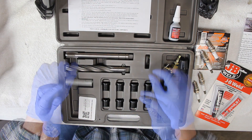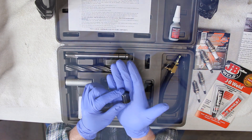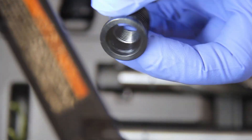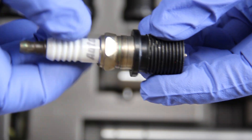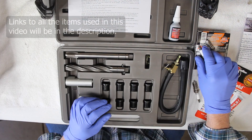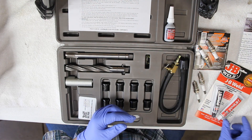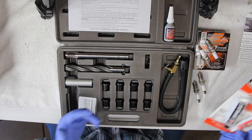These here are all of our inserts — it includes eight of them. Here's an up-close look: they're made of steel and very well made. The spark plug threads into the insert and stops right at the end, so all of the spark plug threads engage the insert, adding more thread engagement to the head. To secure it I'm using Time-Sert 60-20 thread locker on the threads and JB Weld around the shoulder of the insert to help secure the whole thing.